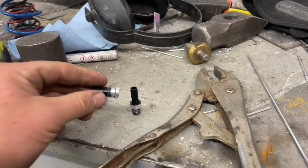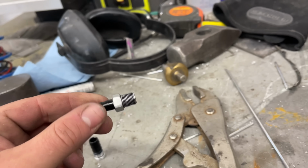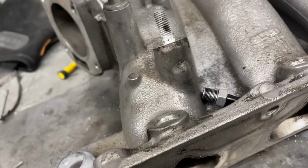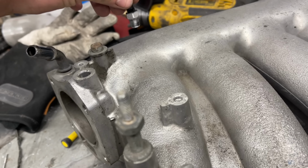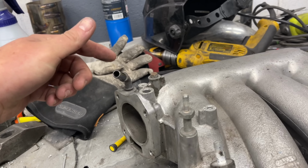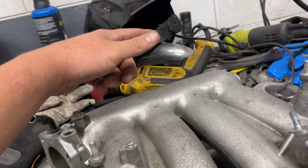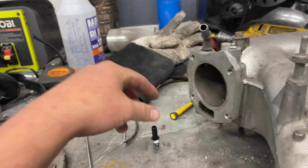And so I went to the neighbor's and he had these two tiny little aluminum nipples, and I'm going to put them not there. I'm going to put them up here or back here or something like this, because we need the blow off valve to come from one. We have the fuel pressure regulator that's going to go to the other one. I swear I had like six T's going all kinds of places. So I've got to cut that one off yet, cap it, weld those on.